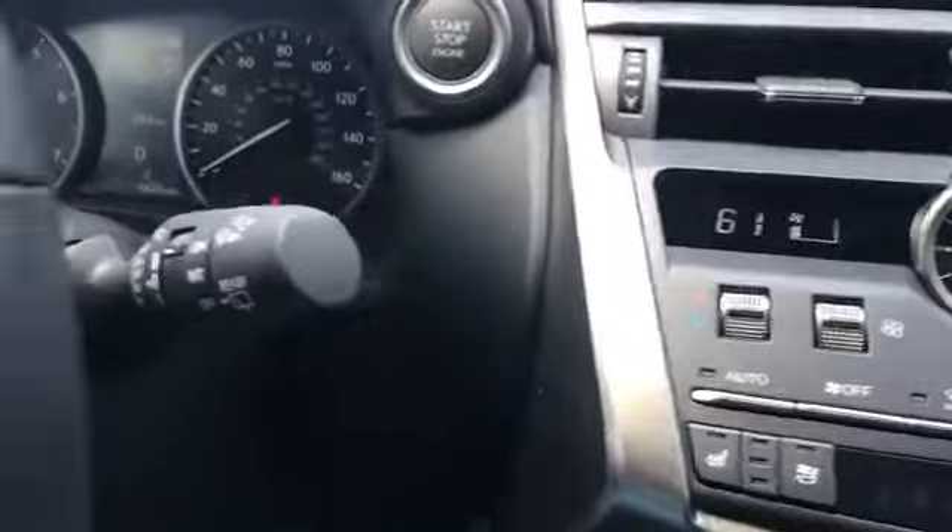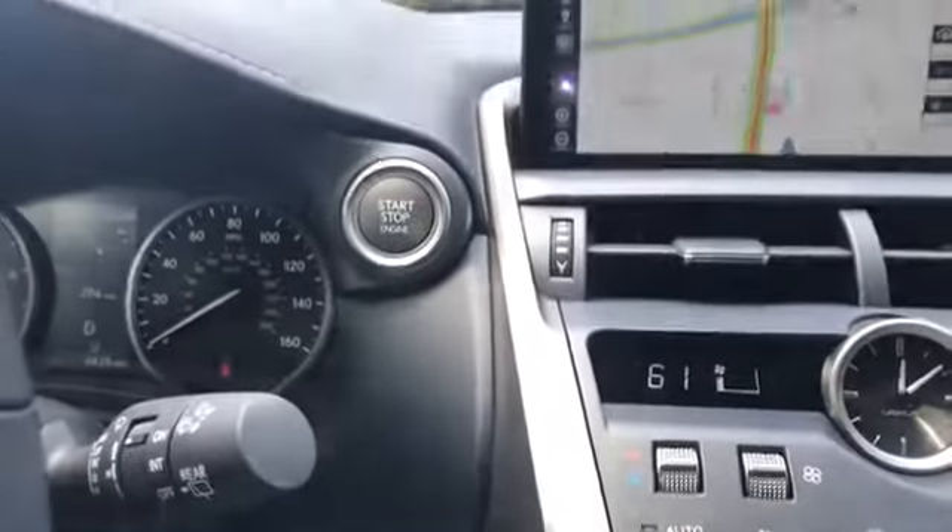Now let's say the train is gone, the arms are up and I'm ready to go again. All I have to do is tap on the accelerator and I'm ready to go again. When I come to a complete stop I see the brake hold activate again. Once I see it activate, then I can remove my foot from the brake. So it's not going to stop first — you do need to be paying attention to the fact that it is engaged. Number one: it needs to be turned on. Number two: you have to have your seatbelt on. Number three: come to a complete stop. Number four: when it says 'Hold' in gold — hold in gold — then you know you can take your foot off the brake.